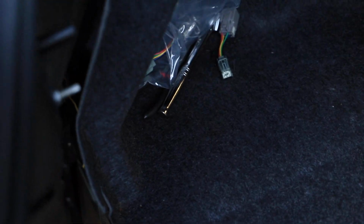Don't let the third tail light discourage you. It's not that hard. Don't be nervous. So what we did was, I ran the yellow wire, which is the one that goes to the brake, and the actual tail lights itself. I ran it all through here, ran it up through the sleeve, and then you go back in the car.